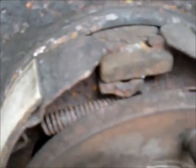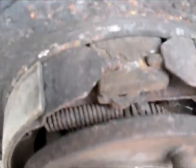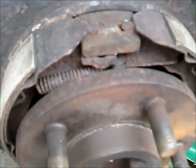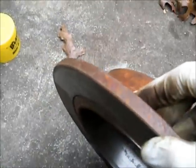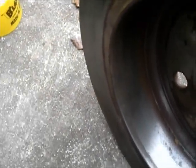Inside you can see the tone wheel for the ABS brake system, and everything's a little rusted, but overall it's not bad. In the back you'll see a lever — that's the cable that applies the parking brake. I use 'parking brake' and 'e-brake' interchangeably, even though I probably shouldn't. Inside this disc brake rotor is the drum part where the e-brake goes. I just scuffed that up with some 80-grit — that's what we do at work when we adjust them.